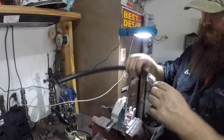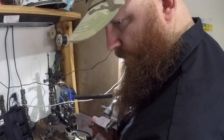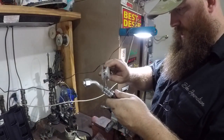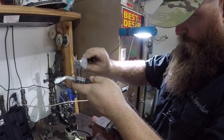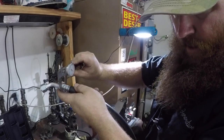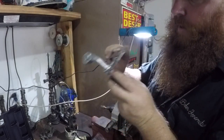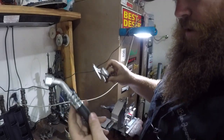And it looks like a pretty good crimp, and the instructions say that number 8, which is what we have here, should be 0.83 for the crimp size on the most inboard section, which I can't really get very well. And I have a 0.835. We're going to call that good enough because the type of calipers that I have don't let me set all the way into these grooves, but 0.835 is a good crimp.